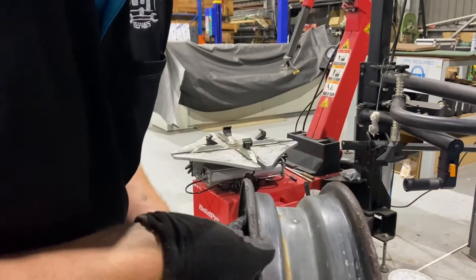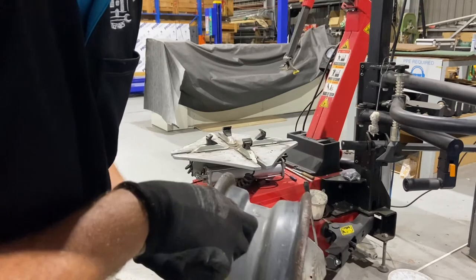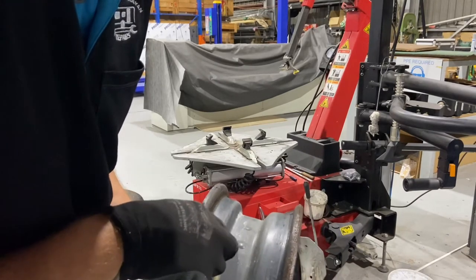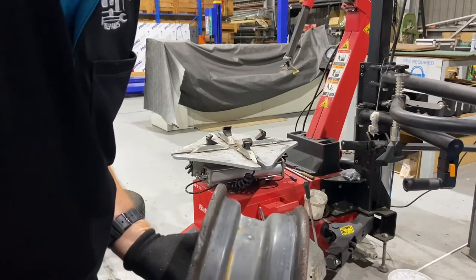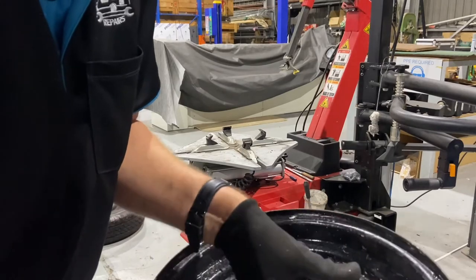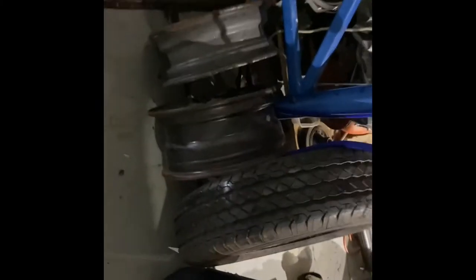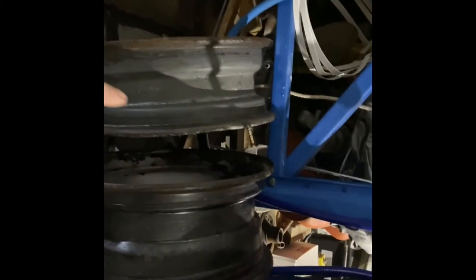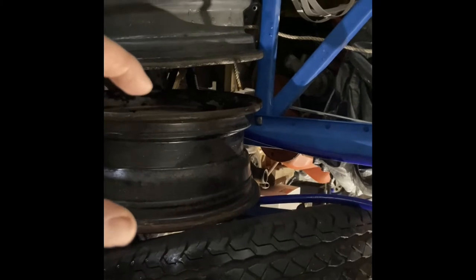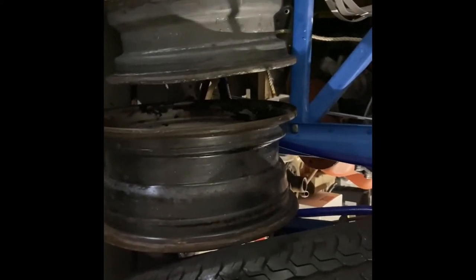I was trying to read the information on the inside of this wheel. On the other wheel, I couldn't see it. 13 by 4.5, 4.5 inches, 13 inches. I think it says 015/58, Holden 22. So they're genuine Holden wheels. So 58, I believe, would be 1958, the year of manufacture. Cool. Just a quick moment of interest. So 1958, 5 inches wide, standard Holden wheel, 5 inches wide, and that aftermarket one, ROH wheels, still make wheels today, 6 inches wide. So it's a pity that one's damaged, but it's not safe, so we can't use it.